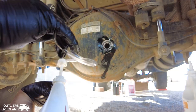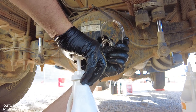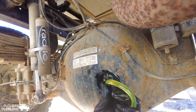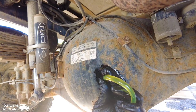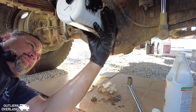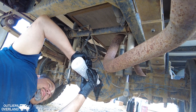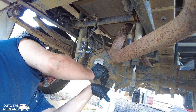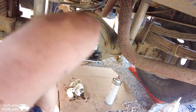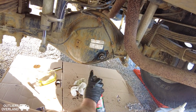That's tight enough for me. Time to fill things up. We're using the limited slip oil here and pumping it in. The owner's manual says 4.8 quarts, so we got five. Decided to ditch the pump and just cut the tips off these bottles — the pump wasn't pumping quite as well as I would have liked. Running out the hole there. Let's tighten up this fill — tight, but not quite what I was dealing with on the disassembly part. A little brake cleaner to clean up the area.